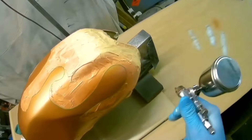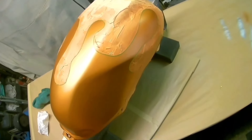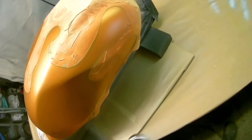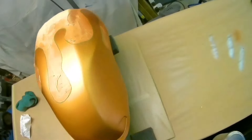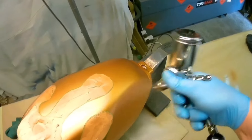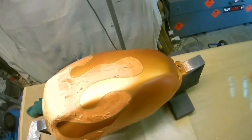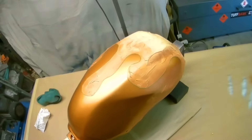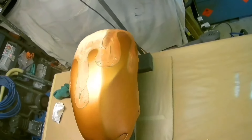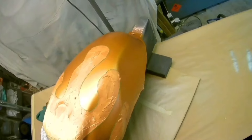Having something like this that gives really fine atomization at really low pressure allows you to keep it on full fan and just add material as you want. I'm not trying to mimic anything — I'm just going for a look, literally quite happy just adding material until I think it looks about right. I'm using all metallic paints, and then we'll go over with a yellow candy coat.